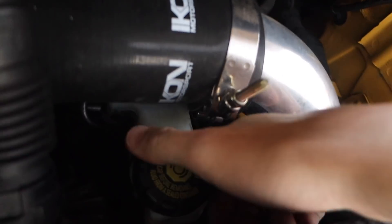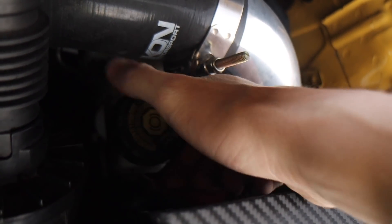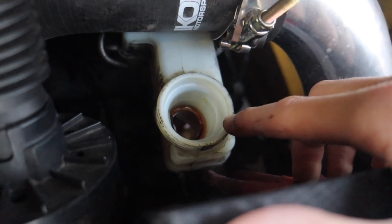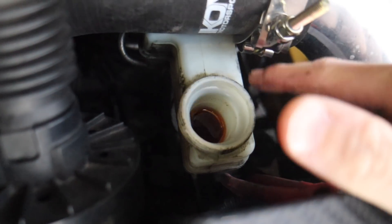Because we're working on the brakes, move the brake fluid cap off just so when we push the pistons back there's no resistance or anything. I could probably do with getting the fluid changed as well, but it's short notice so I'm just going to do the pads.